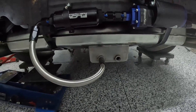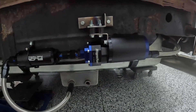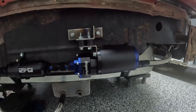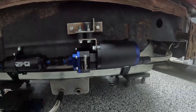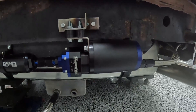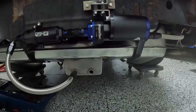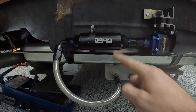Back here we've got the mighty Magna Fuel 4303. Surprisingly, they only rate this at two and a half gallons per minute — that's only about 567 liters per hour at 12.5 volts. This car will see 13.5 volts, but still the pump isn't even 600 liters per hour by their rating. I see so many people making 800–900 wheel on E85 with these, so I think I'm going to be alright. Magna Fuel says you can mount the pump 18 inches above the sump; we're sitting at about 10 inches above, so hopefully I'm fine.